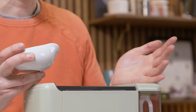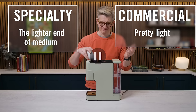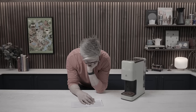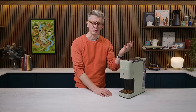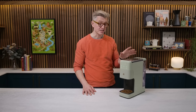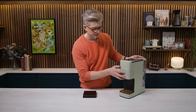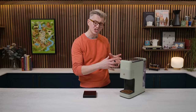I don't have really dark roasted coffee beans here — I have what specialty would call the lighter end of medium, and what commercial would call pretty light. We got stuck in a loop where we programmed it to come on later by mistake, and then it wouldn't let us do anything — it was just going to lock you out of all functions until it was going to brew tomorrow morning, which is a horrible piece of menu design and a terrible flaw in the software. But moving on — we've selected eight ounces. You can go anywhere from six to 16 ounces in two-ounce increments, which is lovely. What I'm going to do now is interrupt it as it's brewing because once it's ground the coffee, I want to see how much coffee it's grinding for an eight-ounce brew. There's a little pause — it doesn't grind straight away; it seems to do a little bit of preheating first, and then the grinder kicks in.